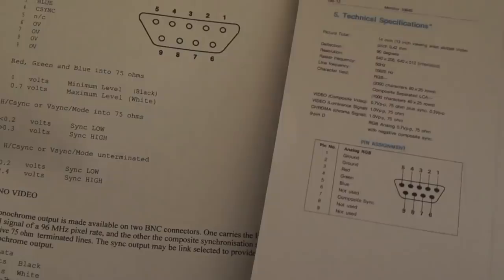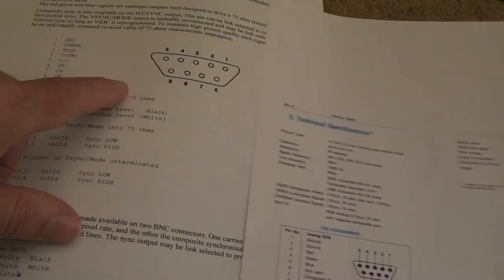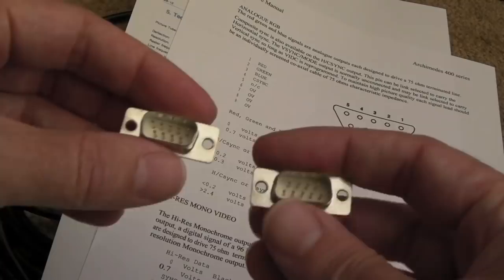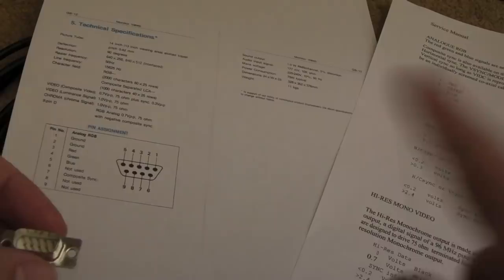One of the things we need is a video cable. I can power this on - I'm told it's got a hard disk fault - but I can't see anything. The video connector on the back is 9-pin female. I've got connectors here, and it's the same on my Commodore 1084S monitor, because that monitor should work with this - I'm told it's the same as a model Acorn used with the Archimedes. I've also ordered a SCART cable, though I'm not sure whether that'll work depending on the frequencies and resolution.